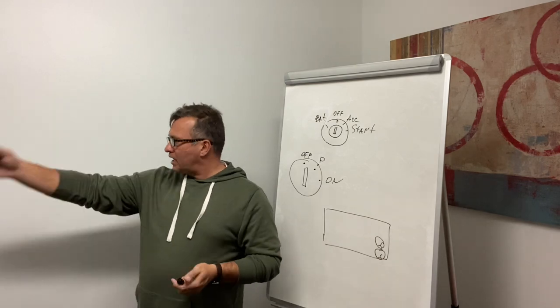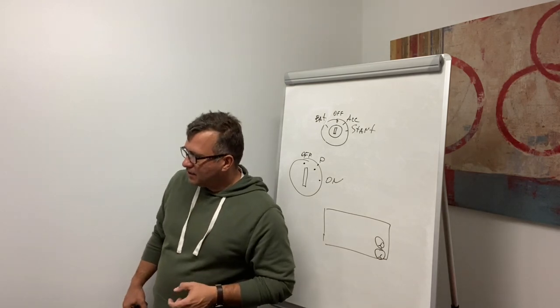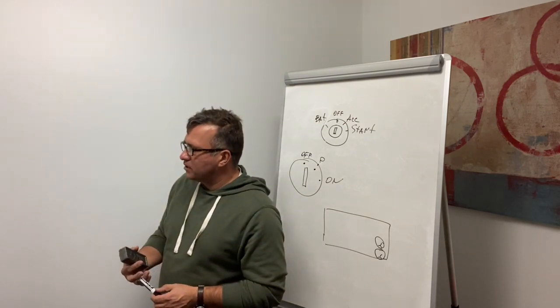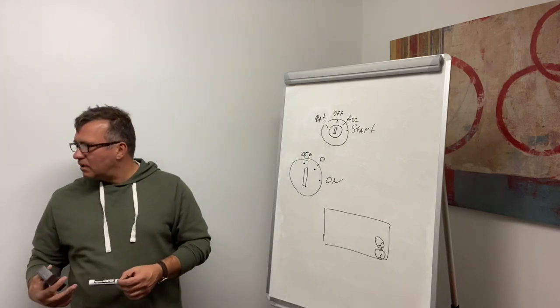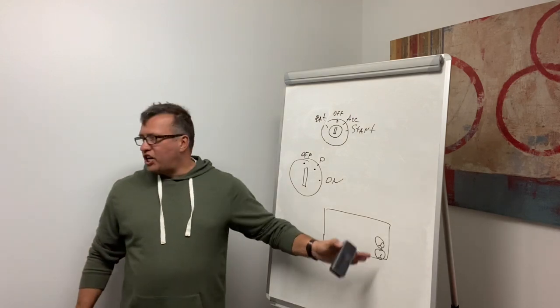Building up pressure, say it, until what? We're building up pressure until the governor cuts off between 120 and 140, very good. We've checked those gauges.